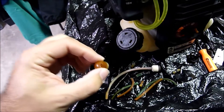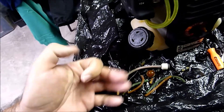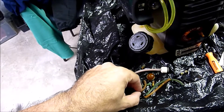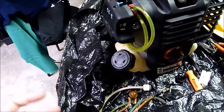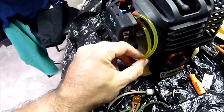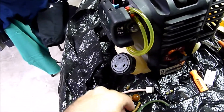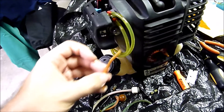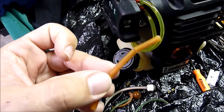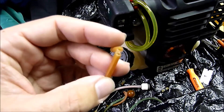So if you have run pump gas before — not the normal pure 100 low lead that doesn't have any ethanol in it — you should probably go check any fuel lines like this, or plastic and rubber components. Look for the color difference, because this used to be kind of a yellow color, and you can see now it's all frosted over and splits open easily.